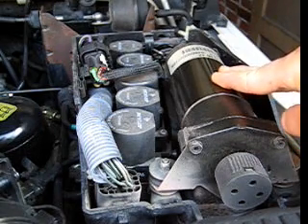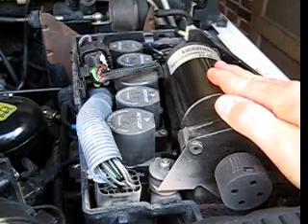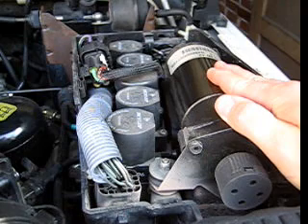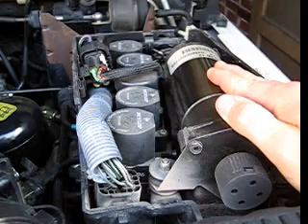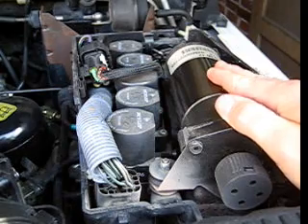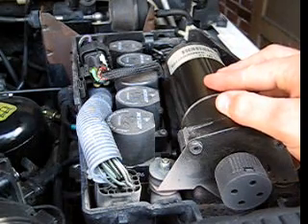This is a situation where the compressor is actually working properly. The compressor can be triggered manually — you have the EAS unlock software where you can trigger the compressor and it runs properly — but during normal operation the compressor is just simply refusing to run.